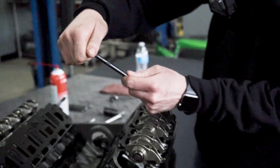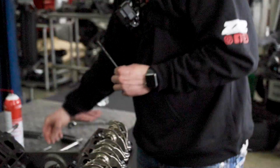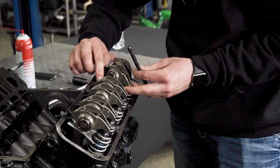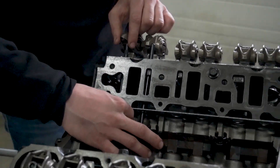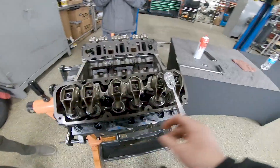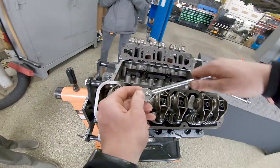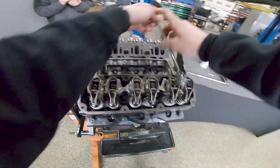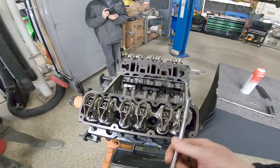So what you want to do — I'm going to set this at 7. We've got our length checker set at 7. You can use your stock pushrod or whatever you have around to put on the other side — you're going to need two. Go ahead and snug them all down. I like to put them all on and snug them down just to make sure the pedestal is in the right spot and everything is seated so we don't get any skewed readings.